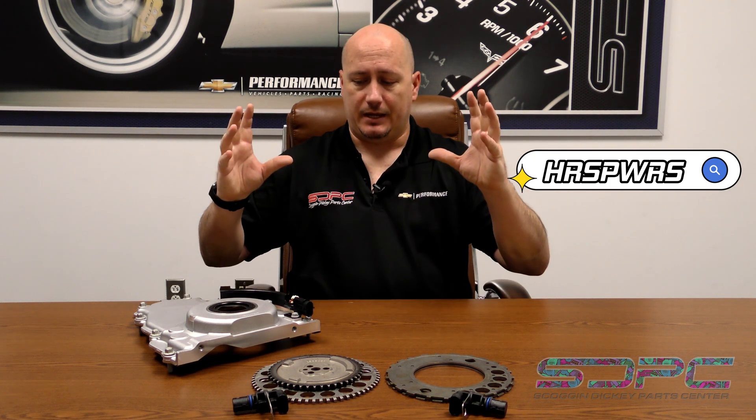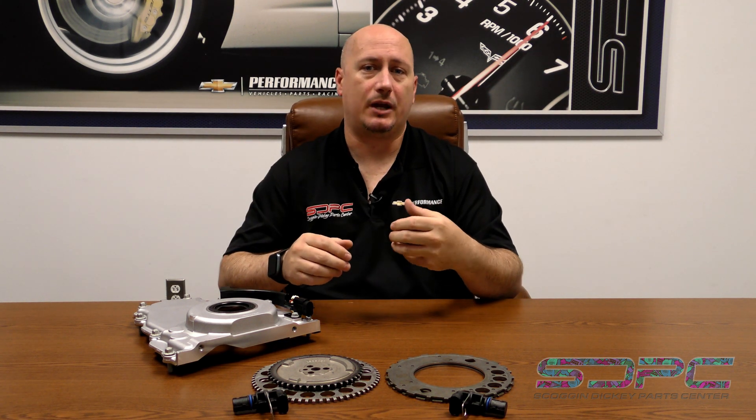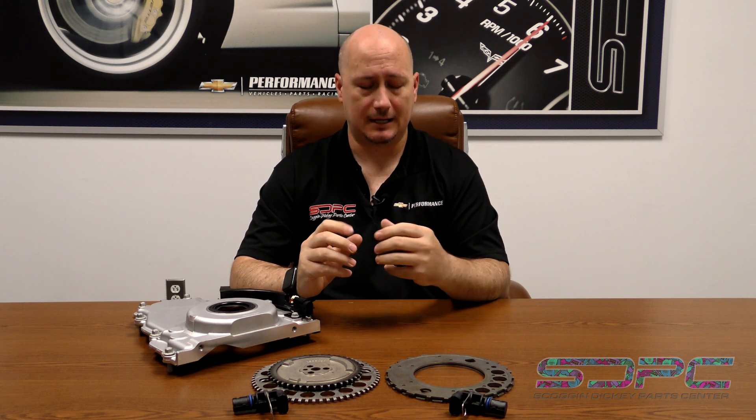I'm not going to go through every single part of it because people have already documented it and there are other YouTube videos of performing these swaps. Just use Google. As for throttle body and intake setup, you're probably going to drop the LS1 intake and move to something else — maybe a Holley Hi-Ram or anything like that. Pay attention to the power band of your camshaft plus your intake selection, because if you're running a really short runner, you're going to have to spin the engine high to start making any power, and you might already be out of the cam's power band.